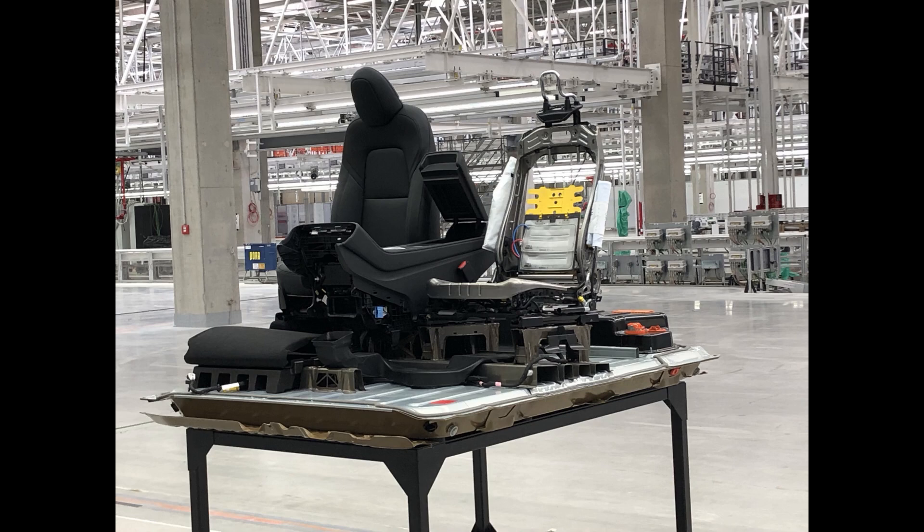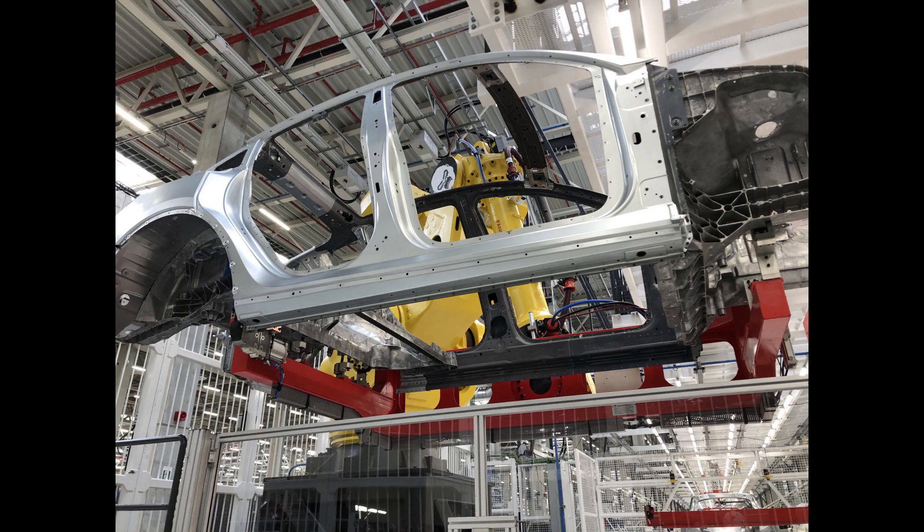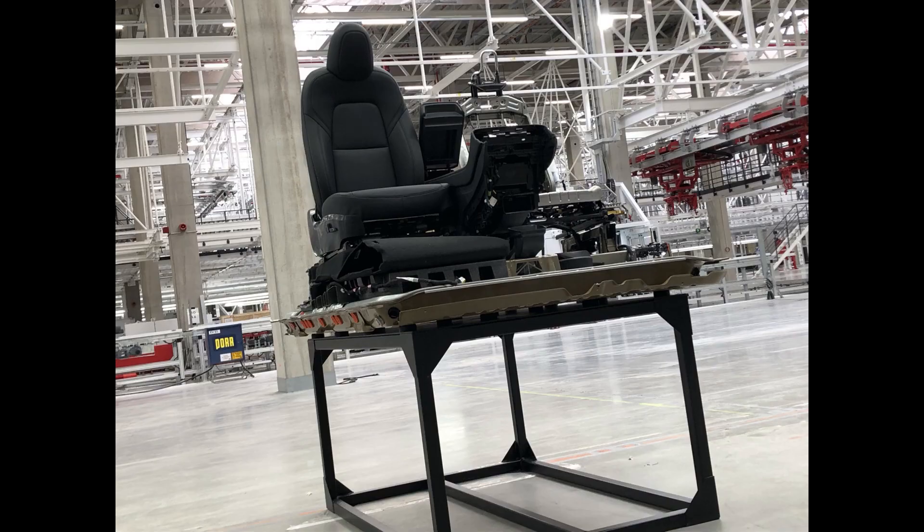You don't have to carry the seats inside the closed car body — you simply assemble them onto the well-accessible top of the structural battery pack. The same goes for air conditioning channels and cables that have to go into the cabin; they will be put onto the pack, then the black plastic pallets go on top, and finally the carpet on top of those. So you have all the front seats, the center console, and everything ready pre-assembled, to be pushed into the car body from below through the frame. Then the battery is connected to the car body, and the seats, carpet, and center console including harnessing are already inside the cabin.